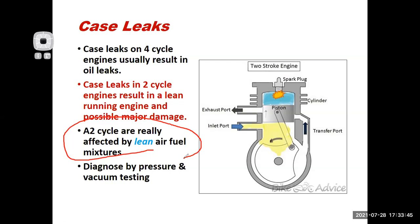And that's another good point, that the main seals themselves around the crankshaft area are something else I want to spray with soapy water to try to find the leak there. The main seals on this bike are essentially the leak, and they're allowing oil to suck in from the transmission and be burned in the engine.